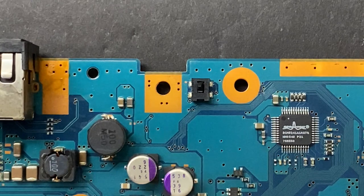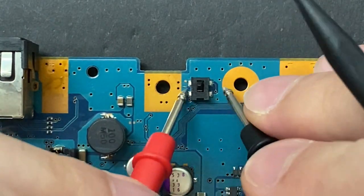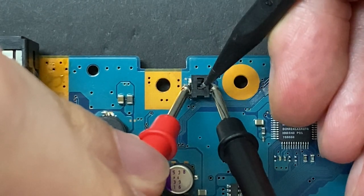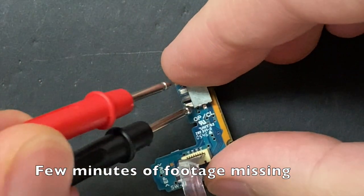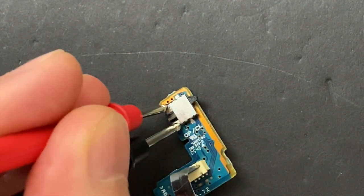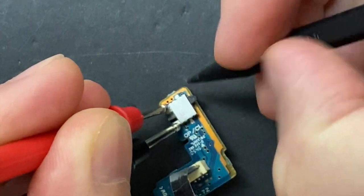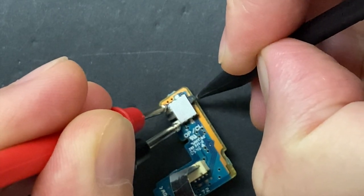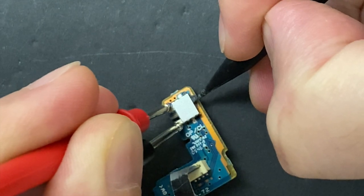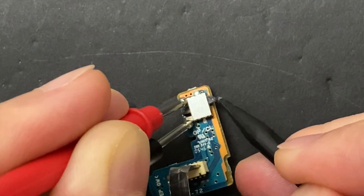All my fuses turned out to be good, so now I shift my attention to the lid sensors. There are two lid sensors on the PS2 Slim and their job is to let the system know when the lid is open or closed. This switch looks like it's doing its job — but I missed recording some footage. I've been messing with it for about a minute, and it's kind of inconsistent — it's like it has a dead spot. I did push it in 20 or 30 times already, so maybe I loosened up some dirt that was in there. I think messing with it made it better. I think this is the problem.